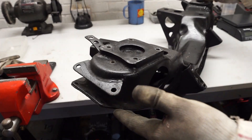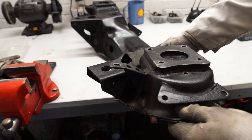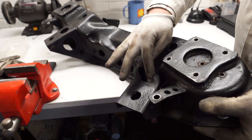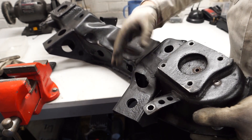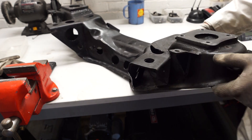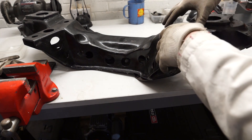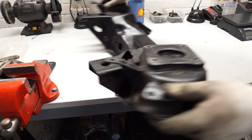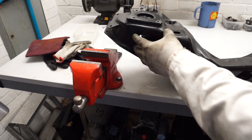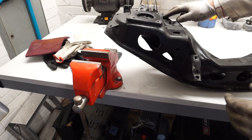The UK driver's side — the right-hand side — took most of the impact, and you can see on the cross member here where this hole has deformed very badly. This part all creased up and caused the chassis leg to get damaged. So for the Mark II cross member I definitely won't be putting any holes in this area, as I'd like to keep that as strong as possible. I'm still very tempted to keep the hole in this other area because I think it flexed up a bit and that did save the chassis leg somewhat.